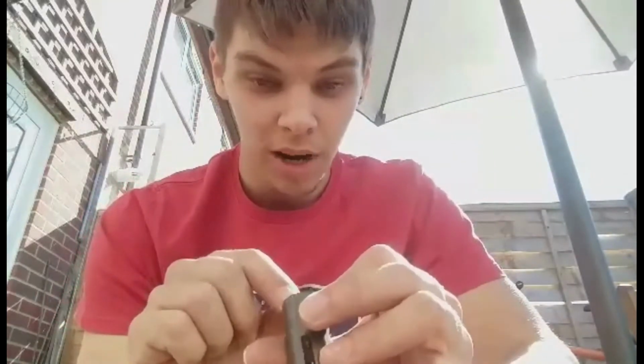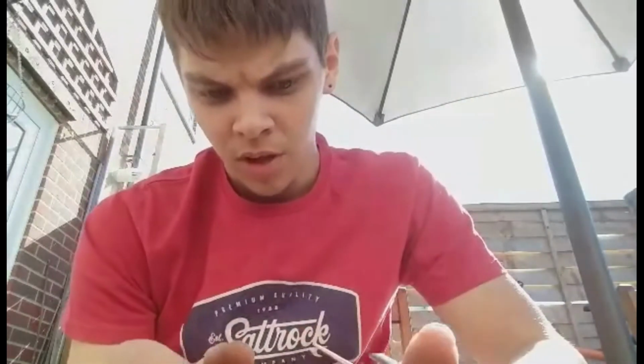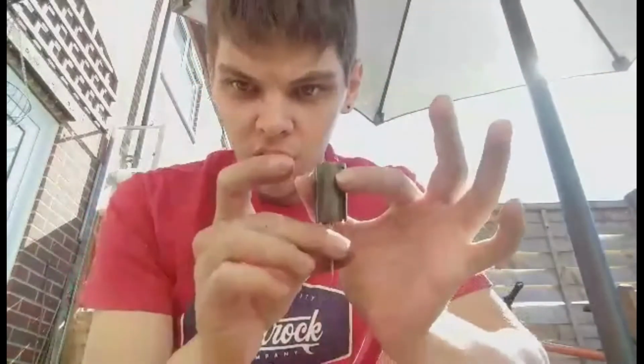But he actually ended up cutting up a Coke can and folding it and making that my clip, a Coke can, right? How smart is that? So that kept the needle in place, but one day, after using it for quite some time, the Coke can didn't do its job and it kind of fell out. So the needle was bouncing everywhere and it was causing my bike to just bog around, and I could give it throttle, but I would be jumping around a lot. And that was because my slider was just bouncing up and down.